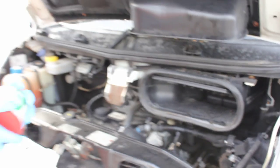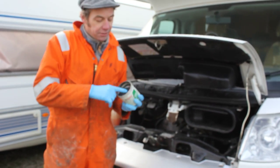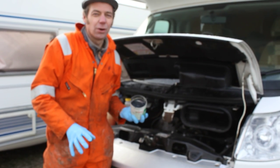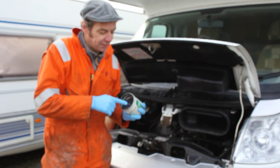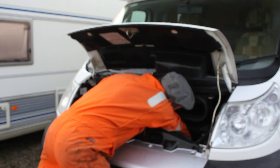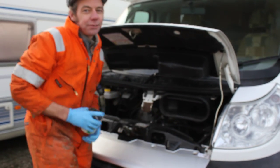If that helps, once you've got it all sorted, drop your torch down inside the engine bay, get yourself some grease and put that all over those linkages to finish the job off. The WD-40 is just a thin oil, so basically the first time it rains it'll get washed off, the solvent will evaporate, and you'll be back where you started. So give those joints a good coating of grease and that should sort you out for the rest of your life.